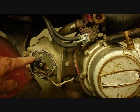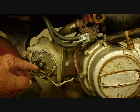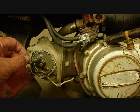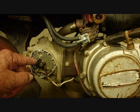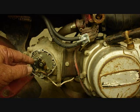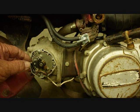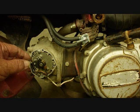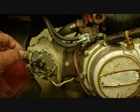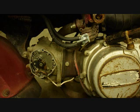Your whole ignition is grounded out. When the points start to open up, as soon as they try to open, there was current flowing through there from the magneto into the ground. The current is going to want to keep flowing and will try to jump the gap. If it jumped the gap and sparked, that would be bad — your points would get pitted and they wouldn't last very long. That's why we have a condenser. As soon as the points open, the electricity, instead of trying to jump the gap, will go in and start to charge up the capacitor.